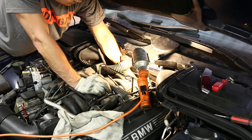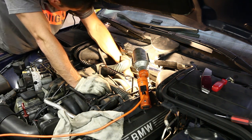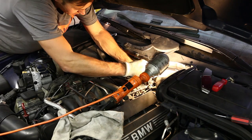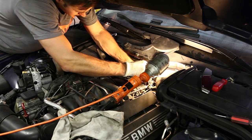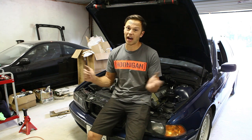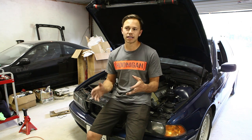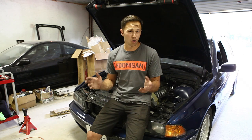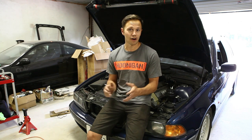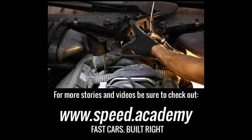I also suggest working on a cold engine rather than a hot one. When tightening the bolts, be very gentle and use your discretion, because it'll be very easy to strip the thread. I just finished installing the new crankcase vent, started it up, and the engine seems to be running well right now, so I think I fixed the problem. All in all, this job's not that bad, but as you've seen it's a little frustrating at times and can take about two to three hours. I think it's still worth it considering this is probably a $500 job at a dealership. I hope you've enjoyed this little tutorial and hopefully it'll save you some money.